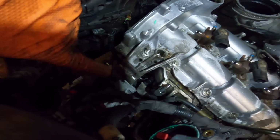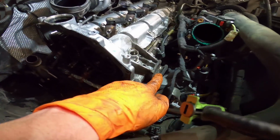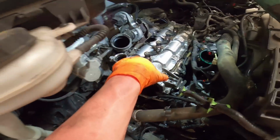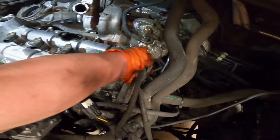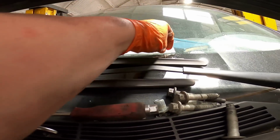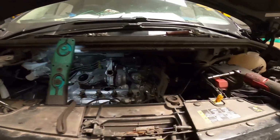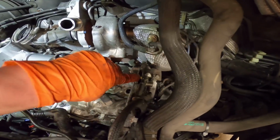Right, been pulling more stuff apart. Took the alternator bolt out the top and I loosened the bottom one, just sort of swung the alternator forward. Don't know where you can see that, just because it hooks around the top here. Took the little foam thing off. Down the back here, 2 little 10mm bolts to take the bracket off over the vacuum pump, and then 3 little 8mm bolts you need a deep socket for. Took them out and popped the vacuum pump out. I'll show you it, but it's not that exciting. But yeah, so the vacuum pump's off now.